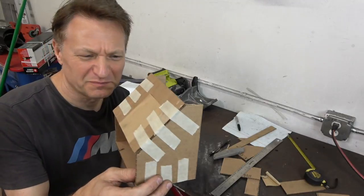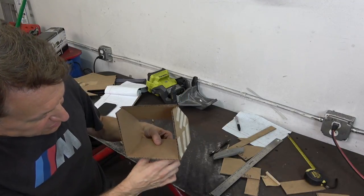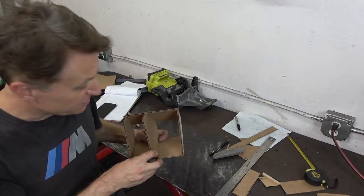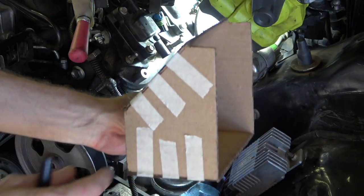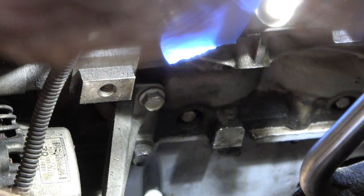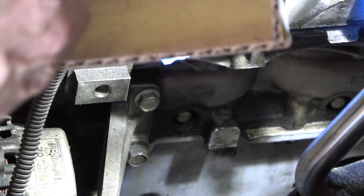Here's what I've got so far — it's like a little birdhouse. This is going to be where the engine mounts up against the block, the bolt going down to the actual rubber mount is going to be here, and I'm going to make a little bit for the back and then another brace in here. Theoretically it should replicate all the angles of this. I don't think my welding abilities are that good, but we're going to find out. The real issue is on this side — it can't be as wide because the alternator bracket is there, and those two bolts would be in the way, so I need to make this a little less wide on this side.